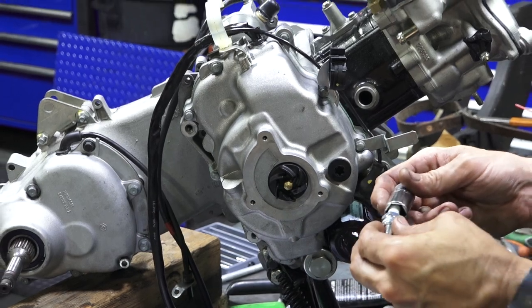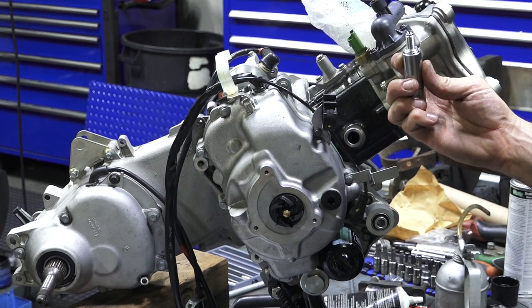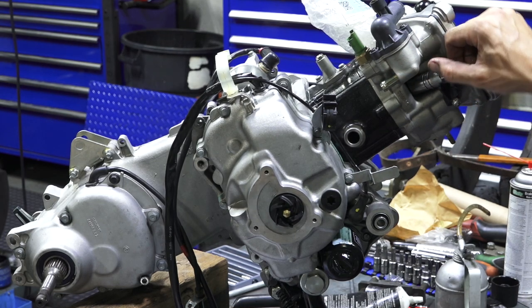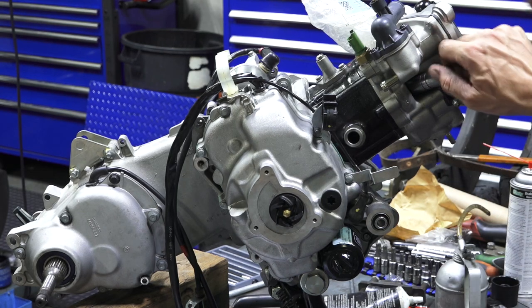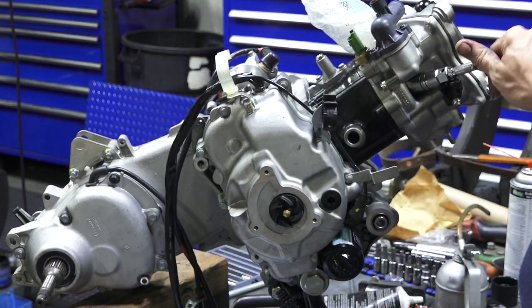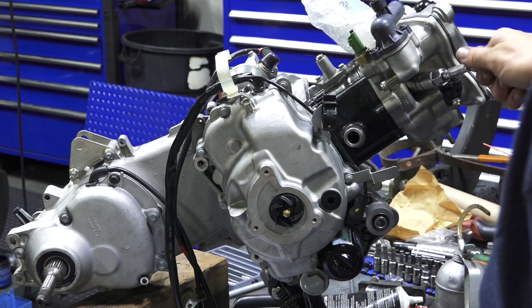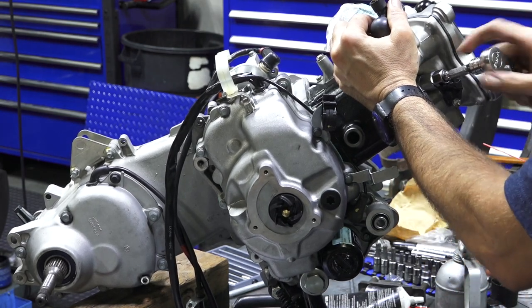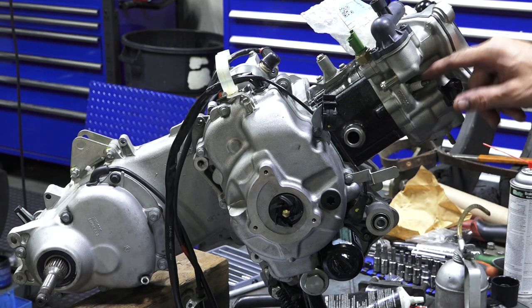I'm using the CR8 EKB, which is the double electrode plug. Early motors didn't use this plug, but this is a direct replacement. You don't need to gap these. They're just ready to go, and they're the longest lasting. The iridiums last quite a long time too, but for the original plug, these last quite a long time compared to the original Champions or the single electrode NGKs that they originally came with. Would I tighten a spark plug another 120 degrees, if that, 90 degrees once it's seated.